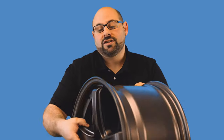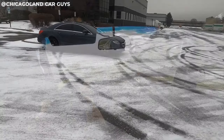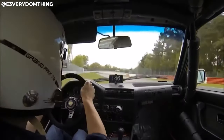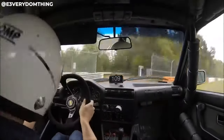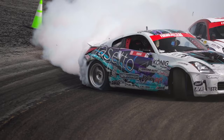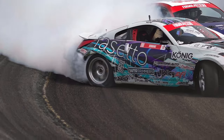Run out can also be found on the interior flange and the front flange. This doesn't necessarily mean the wheel is bent per se, but if you place a dial indicator here and the wheel had incurred curb damage, a hard lateral impact, or maybe you went off track while racing with the wheel turned — the leverage of a tire taking that hit can push the flange back. You can detect this by checking lateral run out with a dial indicator on the front.